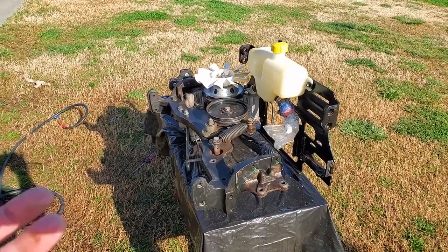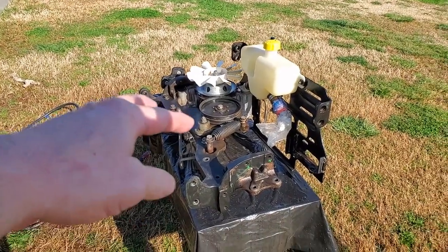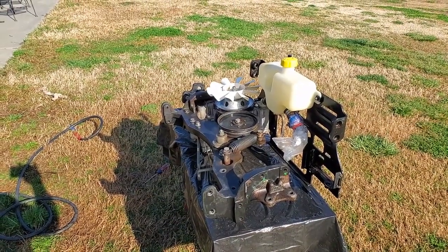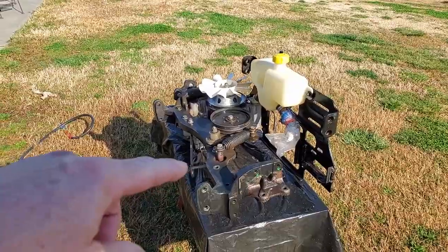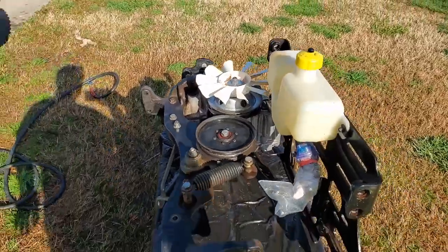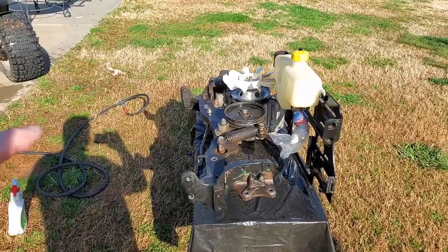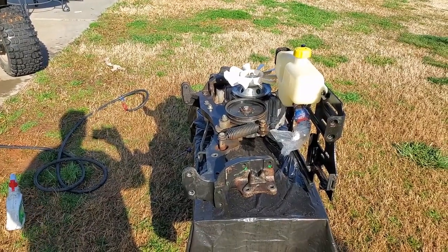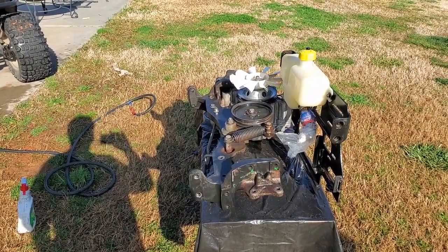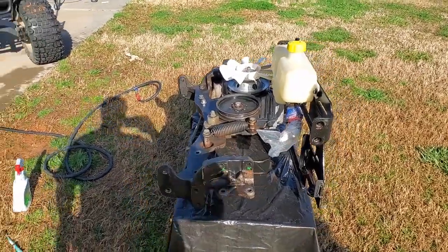But I really wanted to take that whole unit out so I could inspect it and clean it up. I thought it would be an easier task to drop the whole thing out and then just lift the whole thing back up rather than trying to manhandle one unit. Because with this, I can actually put a jack under it, jack it up, and hold it in place while I put all the bolts in — instead of struggling with trying to slide that up, hold it in place, and get everything back in. And by putting this back on while it's out, I can go ahead and put the belt on and get it ready to just go around the engine pulley. That makes it a little easier than having to try to thread the belt around everywhere while I have limited space up in the back of the mower.